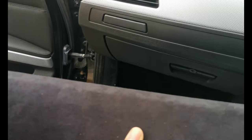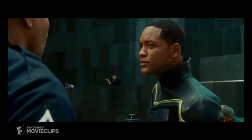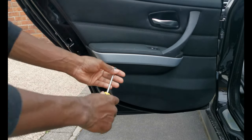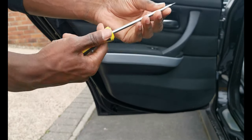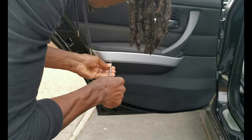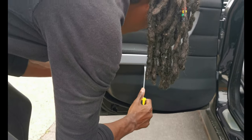This one is the one that goes there and it is very good quality — you can see, very good. The wrap itself, he's done a very good job of it. So this is the rear door trim — it'll be the same for both sides. You can either use a flat head or something like a plastic pry tool. Just stick it under and pry it off — nice and simple.